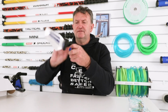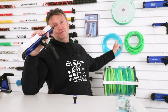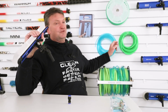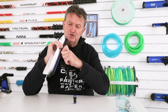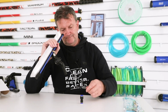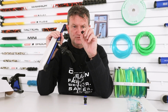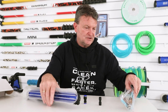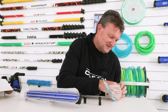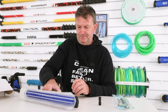So if you have a 1/2 gallon a minute flow rate and you're using something like high flow tube, which is a 3/8 inch OD tube, outer diameter, or 10 millimeter, then you can take this push fit off here. On the brass fitting, right? Yeah, but this time my little filter is stuck in there. So that's why we give you a second one. Not even a replacement, because we just need this one in here.